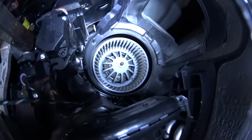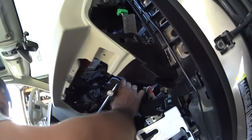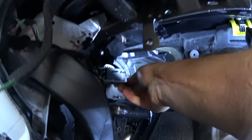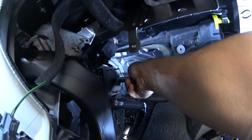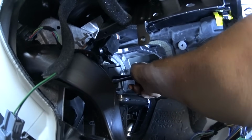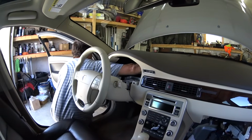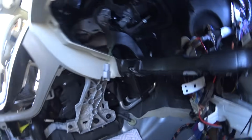Let's put the tool on the fan. With the wider pins, we aim them towards the top. Carefully slide it over the fan, align the center shaft, and you have to feel that those pins are grabbing now that plastic square in the fan, and you can see now that there is some resistance. So we're going to go ahead. Yevgeny is going to push on the tab. He's pushing down at the top, and I'm at the same time rotating the fan counterclockwise.